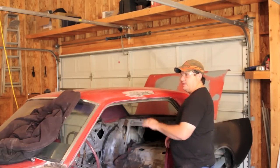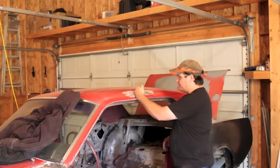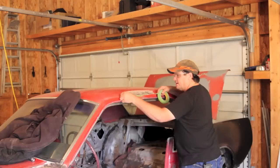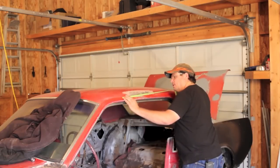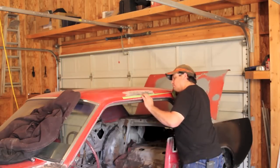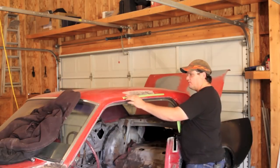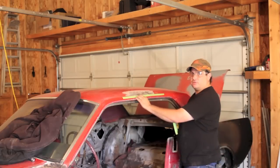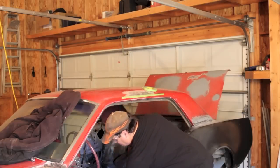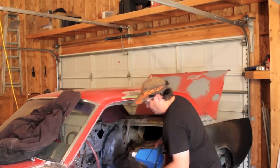Another thing - if it makes it easier for you, you can put a piece of tape here to follow the body line, to know exactly where it's at where you make that sharp, crisp line. In fact, I'll go ahead and do that. I'm going to come up here right where the body line's at and just follow it. That way you know you're going to be pulling straight on the body line. I've got this tape here, and we know the high area is right here and we're going to have to hammer it down. I'm going to put several studs right on that body line. This will probably burn the tape just a little bit.